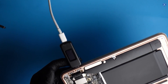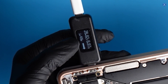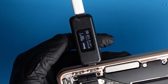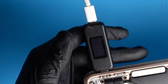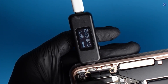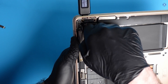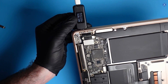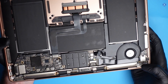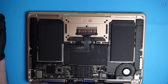Let's plug it in and see what we get. Our USB-C tester shows about 20 volts and about 0.07–0.08 amps, then nothing — it keeps cycling. Usually 20 volts means the USB-C connection is okay and the circuit's probably okay too. This area is getting a little bit warm. We have a separate I.O. board, and there's a little stain there — maybe some liquid damage underneath.